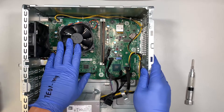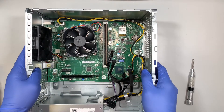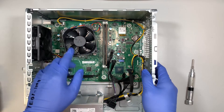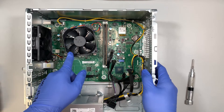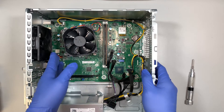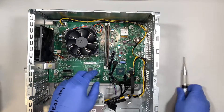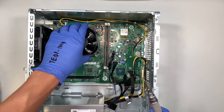This is your CPU. If you want to upgrade the CPU, you can go up to the 10th generation, or you can stay within the same generation. You can upgrade from i5 to i7, or downgrade from i5 to i3 — the motherboard will support it. To remove the heatsink, just unscrew the four screws and the heatsink will pop straight up.